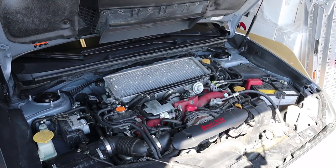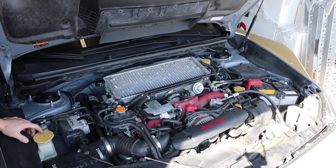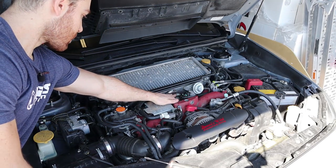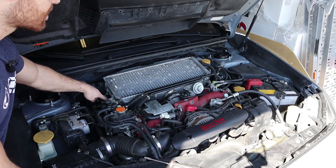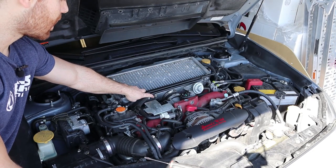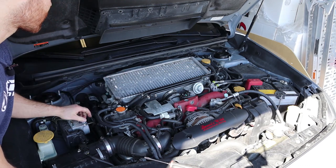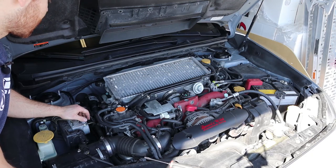The first part of the install is getting everything out of the way, mainly the intercooler. We'll probably have to remove the throttle body as well, as we did on our 2008 to 2014 unit. Basically we're going to take the hose clamp by the turbo, the 12mm bolts for the bypass valve — 12mm on this car, it was 10mm on our GRGV — and the 12mm on the PCV hose, then pull that off as a single unit.